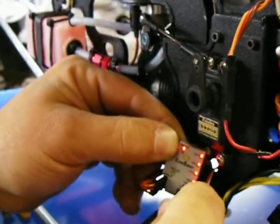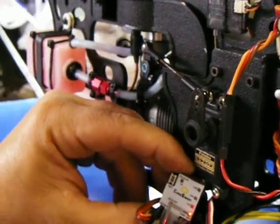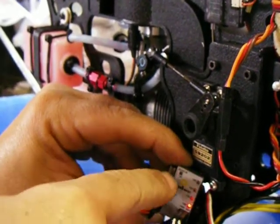Alright, we're going to do the carb smart calibration. Power is off, button down. Power on. We let go. We've got one light. We're going to set the max lean position with the potentiometer. We'll call that there. We'll press the button.